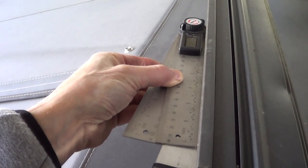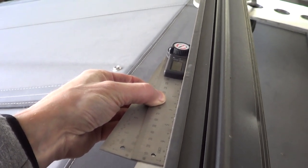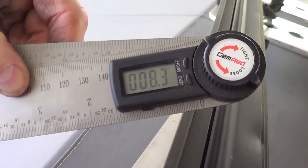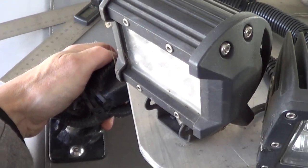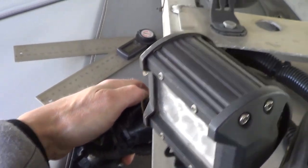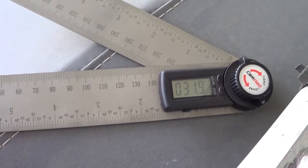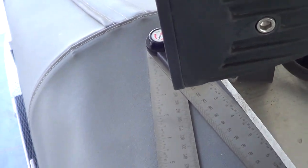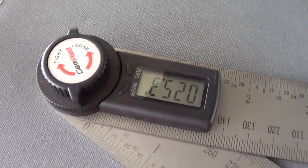Here we've got a digital protractor on the larger lights on the sides — they're tipped off just a little bit, 8.3 degrees off to the side. I was having trouble standing on the side of the bow without falling off while taking the measurement on this one, so you'll just have to trust me that this pod is off about 32 degrees from forward. This rear pod is about 25 degrees from sideways — there's the measurement, it's upside down, but it reads 25.